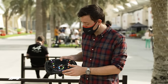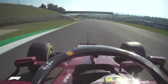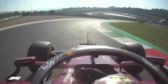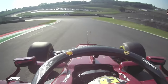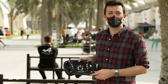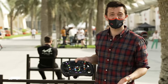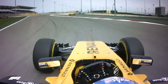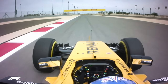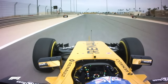There's other stuff on here as well that's predominantly used for testing — you've got aero speed runs, and you've got your delta times on here for when there's a safety car or an in-lap from qualifying, and you can switch to those on this multifunction switch. This is Fernando Alonso's steering wheel from Alpine, but it happens to be the same steering wheel used back in 2016 at Renault. The rate of steering wheel development isn't that great — what's been on there is effectively all the same, and with the same technology on the cars, there's not a lot more that can be done.